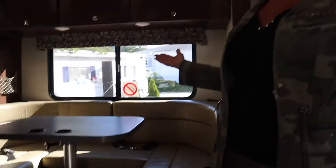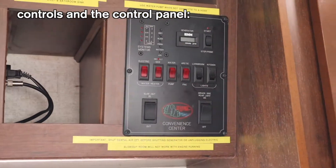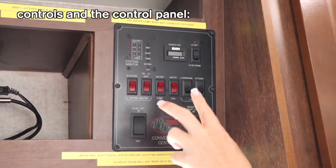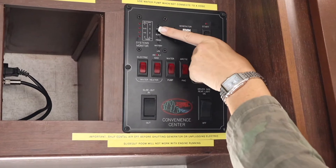So we're going to go inside and let's see what we can find. Welcome to this living space - really small motorhome but super roomy once the room is extended. You're going to notice some electronics here - this is your monitor panel. We spoke about your fresh water and your toilet. On sanitation: gray is your dirty sink and shower water, black is your toilet water, and they also run the bathroom sink into the toilet tank. So brushing teeth and shaving will fill up that black tank faster. If you're in a campground with no sewer disposal at your site, you may want to wash your hands in the kitchen sink.